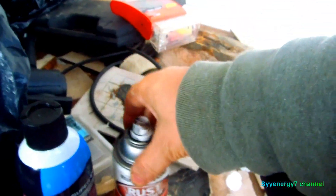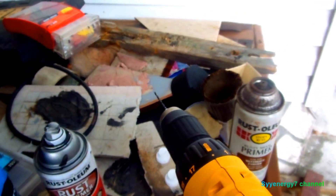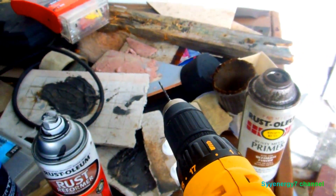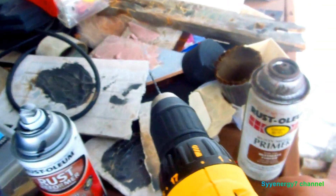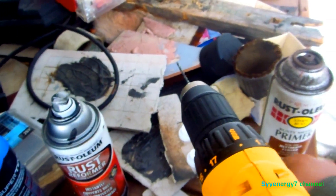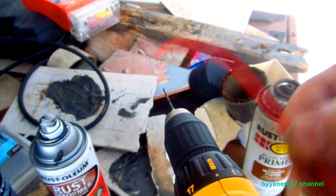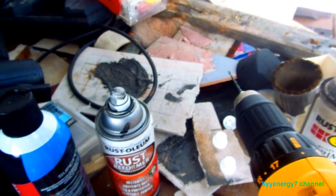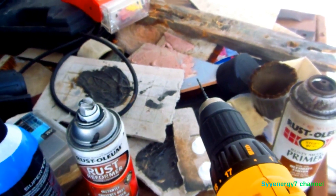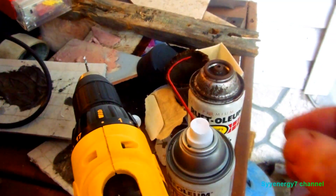This stuff converts rust and it works pretty damn good too. I'm not selling Rust-Oleum here — I think Krylon works okay too and some other brands — but it's cheap, you can find it anywhere, it's not a specialty product. The thing is, you're no longer getting a spray pattern, you're getting a dousing pattern. But a lot of times that's better because you want to get in there with surface rust, douse it down with this stuff, and it'll convert it all over and stop the rust on the inside where you can't get at it.